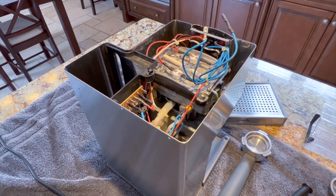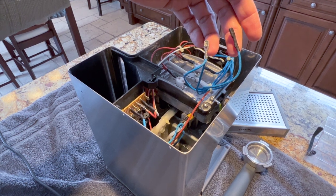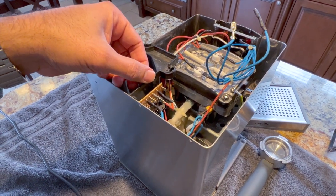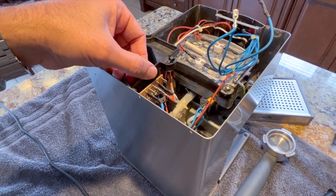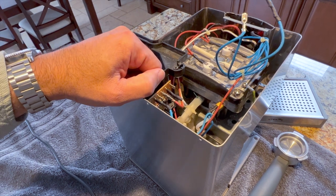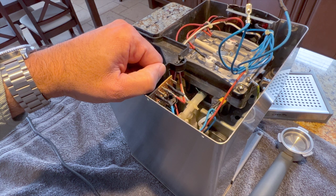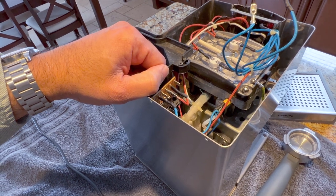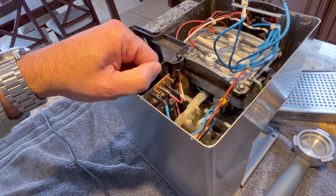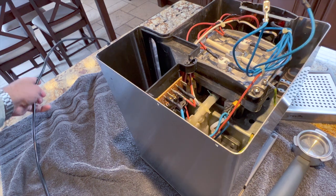What I've done here is disconnect these two leads very, very carefully. Don't just reef on it with your fingers or pliers. This thing moves, so you want to support it really well. Hold that and get maybe a pair of needle nose pliers or even your fingers and very gently pull it off, supporting the unit. You don't want to wreck that circuit board. And make sure you're unplugged — don't want to get hurt.